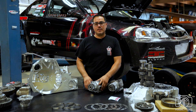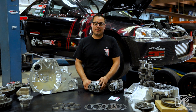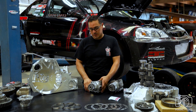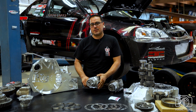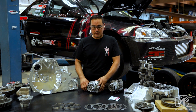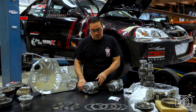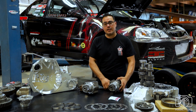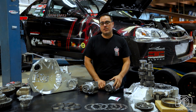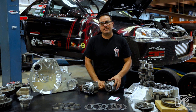When designing this H22 Billet Bellhousing, we wanted to use the strongest OEM Honda components available. That's the reason why we chose the K-series all-wheel drive transfer case. This transfer case has gone mid 8-second passes. I've personally run 850s on a completely stock transfer case. We then upgraded the transfer gear — right here at the end is a PBG transfer gear — and it has gone as quick as 8.22 with a 1.29 60-foot, paired with our Billet Bellhousing.